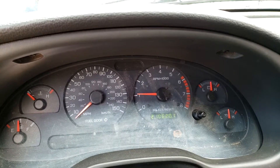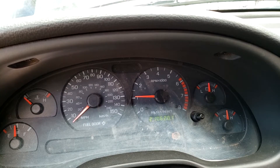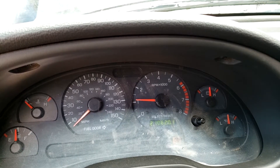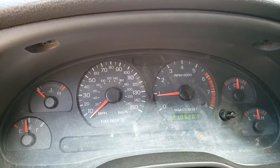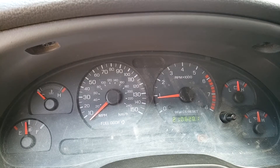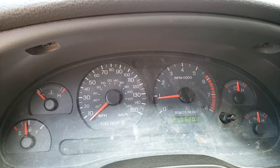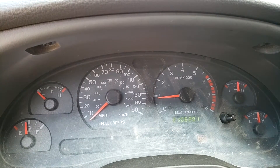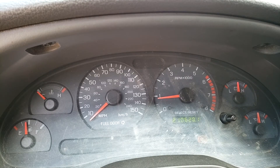Back in the car with a cold engine, you can see it's at about 1100 RPM. After a couple of minutes when it's warm it should drop down. About a minute in, the RPMs are dropping — almost 800 now — and it's not erratic at all. Before cleaning, this vehicle was doing a high RPM thing, indicating the valve was getting stuck open. Now it looks really solid and steady, and that's exactly what we're looking for.